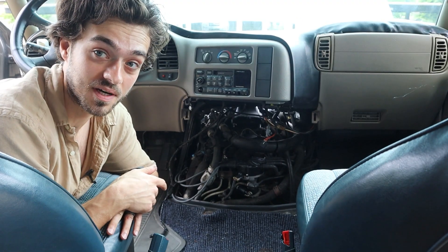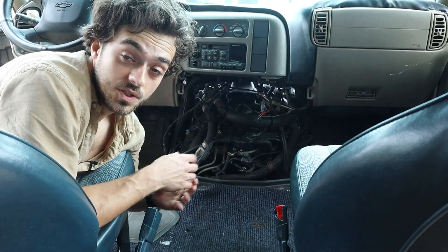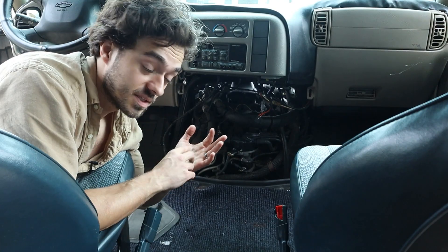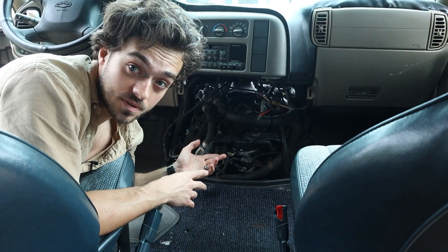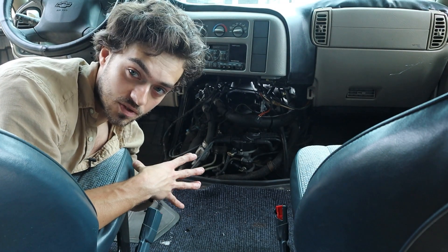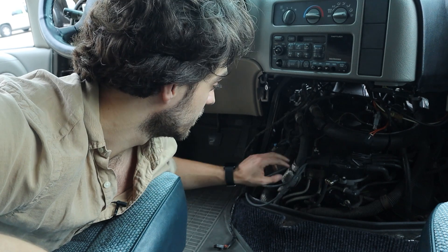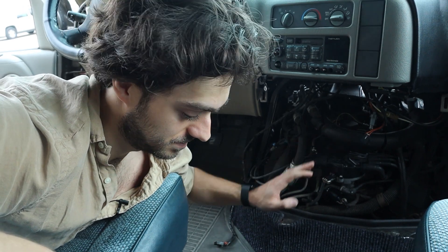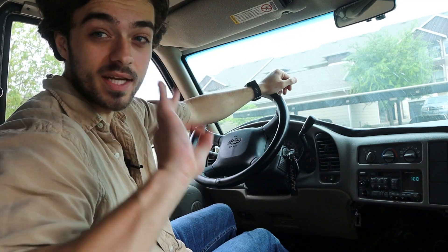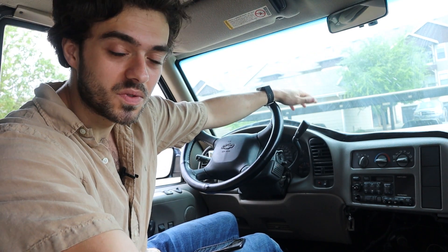Finally, let's get to what caused my misfire. In the last video I was trying to tackle my intermittent misfire — it would misfire randomly at random times. So I replaced the spark plugs, checked compression in each cylinder, checked fuel pressure, cleaned the connections on the distributor with sandpaper, and added Techron fuel system cleaner. The results were that the misfire got a whole lot worse. After hours of trying to figure this out, I found I had swapped the third and fifth spark plug wires. I just swapped them back, and now I have no misfire — it idles and sounds so much better. Simple and silly mistakes can happen to any of us, so if that happened to you, don't sweat it.